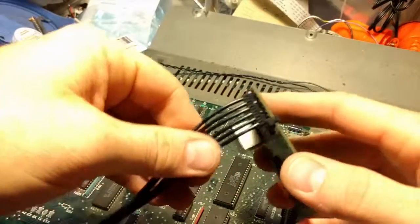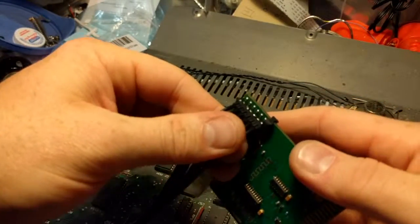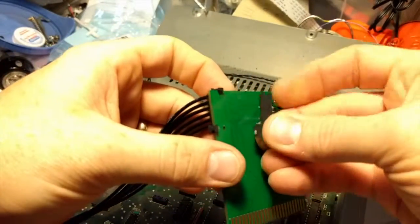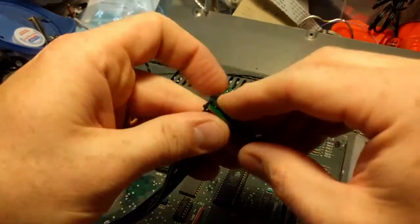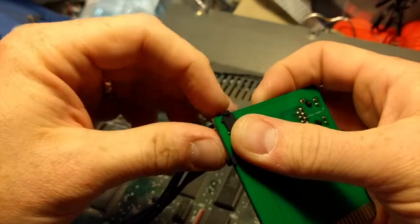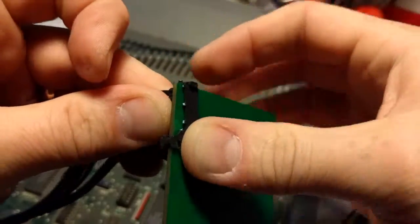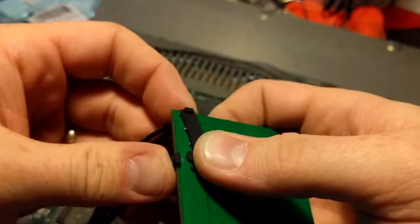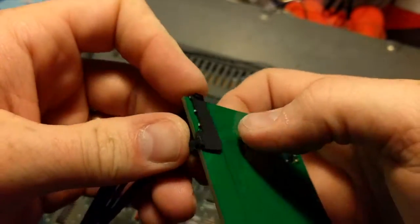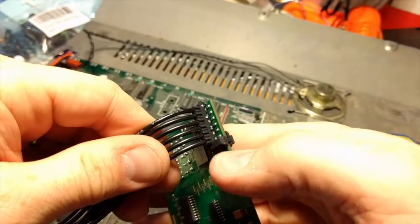By itself this should be pretty secure, but since these fiber optics are pretty stiff they have a life of their own and will tend to pop this off the card as you're manipulating it. So this piece that you broke off earlier comes in as a little bit of extra security. Your best bet is to slide it under the T-shape on the top edge first, and then rotate it around so that it mates up with the other piece. This will hold this end of the light pipe securely to the Ethernet card.